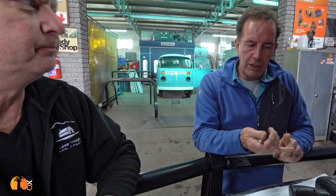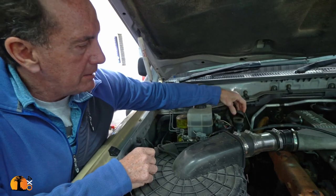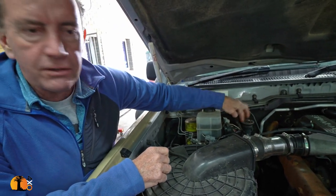That's actually going to start hampering lubrication on the engine. That dipstick is telling me a story. When I check it every day I'm watching how dirty it's getting, how quickly, how thick it's getting. If you leave a diesel oil and don't change it for a long time, the oil gets thicker and more gungy. In the old days high-sulphur fuel used to really hamper the oil — that's why we started reducing the kilometres between oil changes. On expedition I find 5,000 kilometres is a very sweet spot. The brake fluid is quite dirty — that's just lack of maintenance.